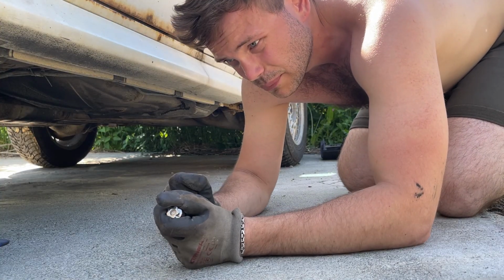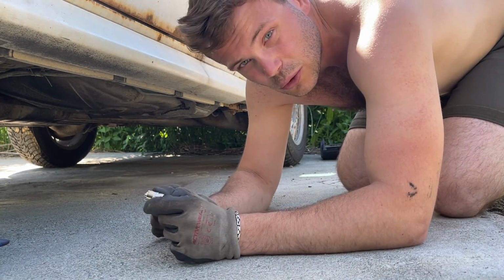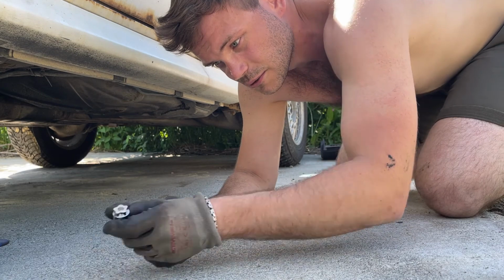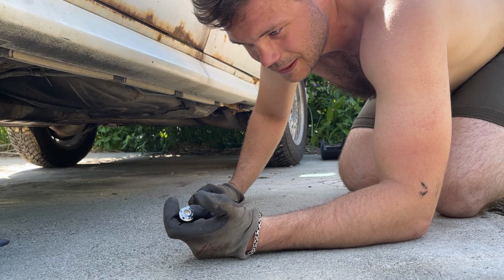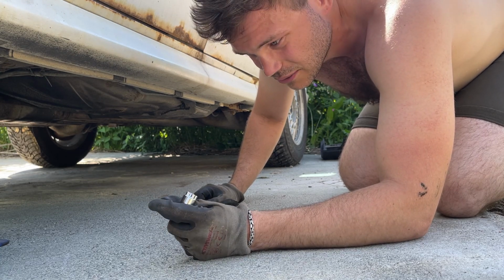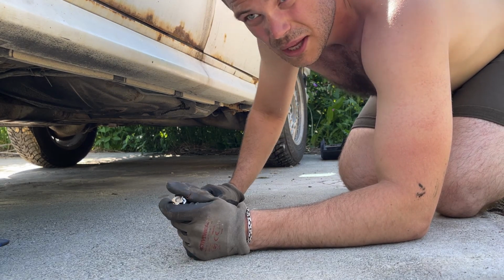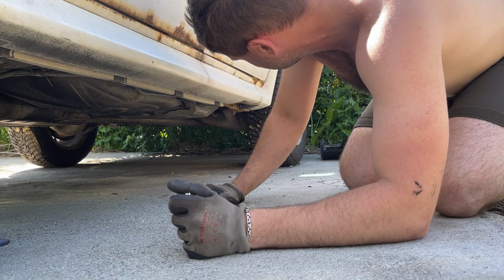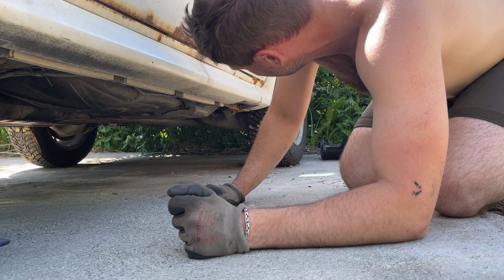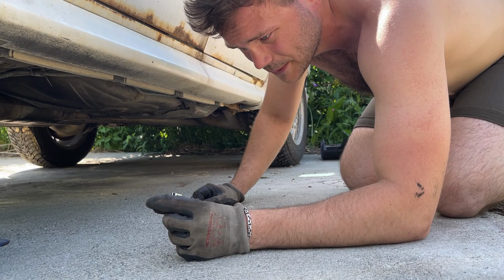It's crazy. One reason why I'm pulling up instead of standing on the wrench is that I'm used to it, because sometimes I messed up and didn't have control. When I pull up on this special lock nut, I have more control and don't pull it in a weird way and wear it down, because in that case it's going to be a pain to get it loose. Otherwise, if you have normal nuts, you could just stand on your tool. But I've just made it my habit to pull it, because of more control.